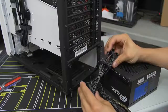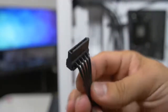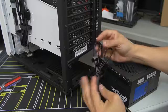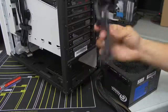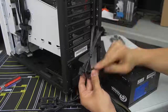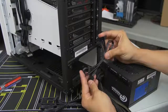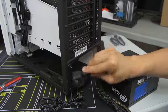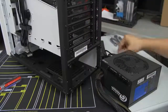What we do need are our peripheral cables. We need SATA power cables for our two drives — both the SSD and mechanical hard drive use SATA connectors. There's actually four SATA connectors on one cable, so hopefully we'll be able to wire both hard drives with one cable — two birds with one stone. We've also got another shorter SATA cable with two connectors that's going to our NZXT Hue Plus. You may have other SATA-enabled devices that need to be powered, like a built-in fan controller. Molex is a completely different plug that does come included with this power supply, but we don't have any Molex devices in this system so we don't need those.